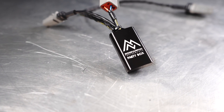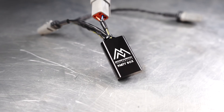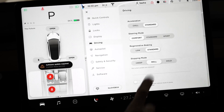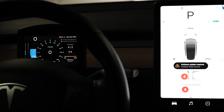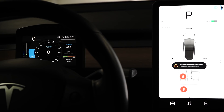So this is our party box — the beta version of it — and this is what's in the car that we're about to use right now. To activate our party box, you press the slip start button. And if you've got one of our Motec C125 dashes, you'll see it activate with some pretty lights, and it'll even tell you what wheel speed slip it's going to allow.